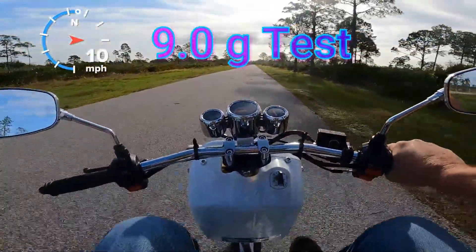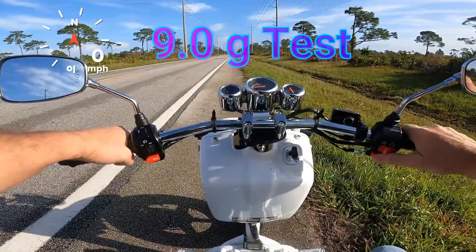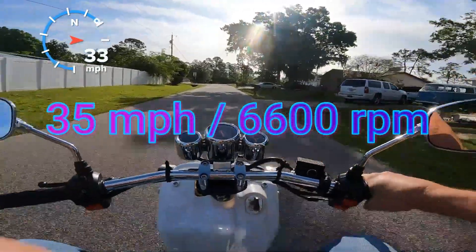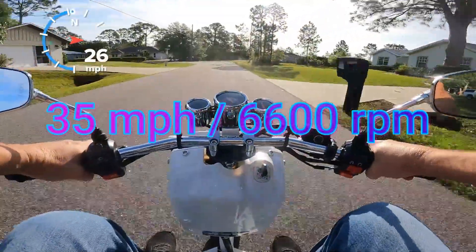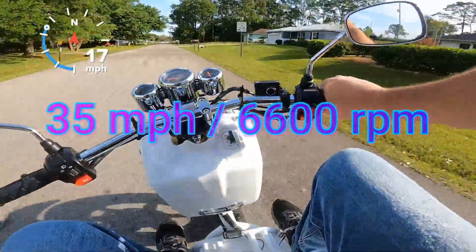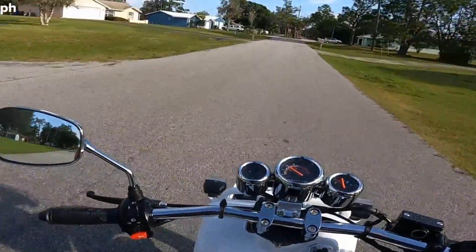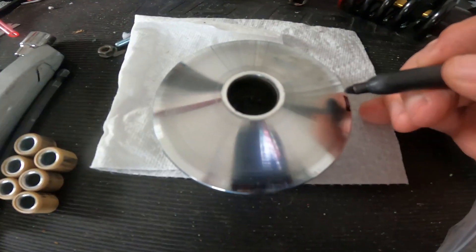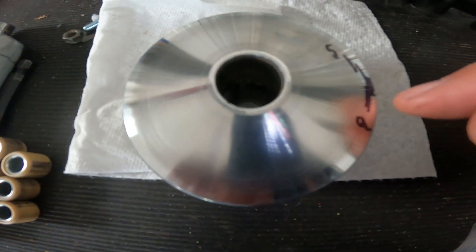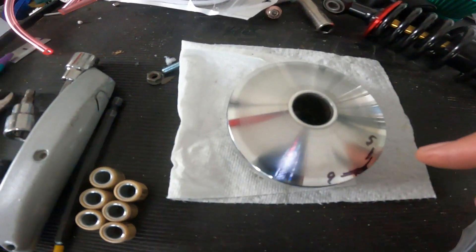You've got to get the RPMs up around 8,000 to get full power. I ran out of road, but I think eventually it would get to a higher speed — it's just ridiculous to try to drive that far just to get to that speed. Once we get some more power in this bike, I think those 9-gram rollers will work pretty good. The 9-gram rollers did move the belt higher on the variator, but it just lugged the bike down to 6,000 RPM. If we had more power, these 9-grams would be the bomb.